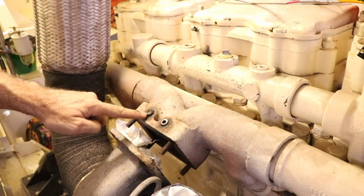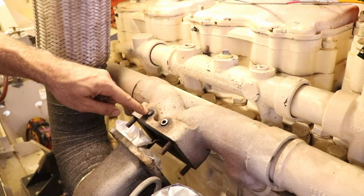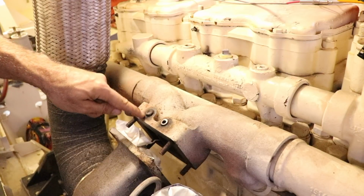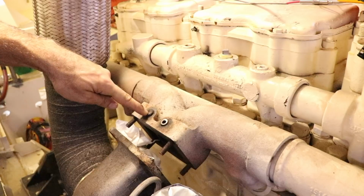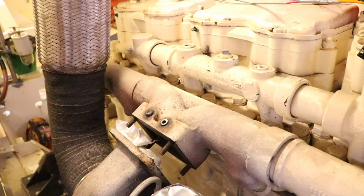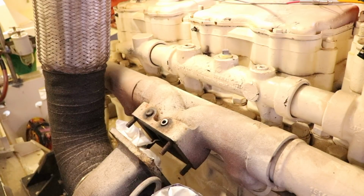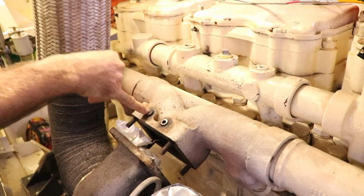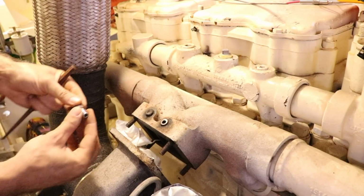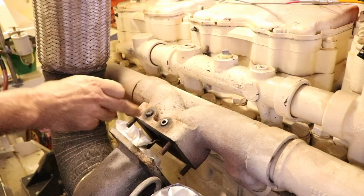So what we're going to do, we've got these two bungs, we don't really have a choice, we have to use these and we can't get them out. So this one has been filled up with weld when I was trying to weld the big nut on. It didn't work and the nut twisted off. I just wasn't getting enough fusion between this bung, whatever it's made out of, and the nut that I was welding. So the plan is, we're going to center pop this weld down the guts of it, drill it out, and then get bigger and bigger until we're out to 8.5 mil, and tap it to 1/8 NPT. The reason we're going to do that is this thread is too big for the probe that we need to stick in here. So this is the probe that goes in, so it's quite small comparatively. So we do need to have an adapter. We can't get this out, so we're going to make this into our adapter. And the flip side is, if we were to do an adapter that raised it away from the manifold, it still wouldn't work because the probe needs to be in the exhaust flow. So doing it this way, we get the right depth and we get the adapter all in one go.